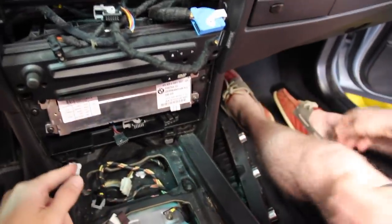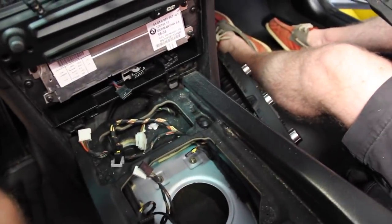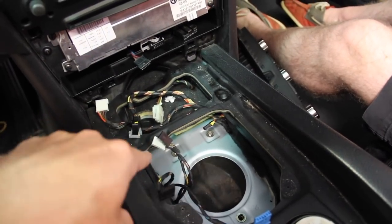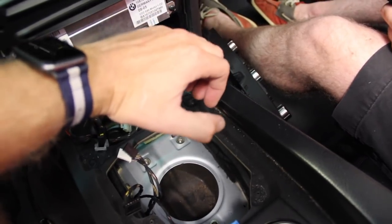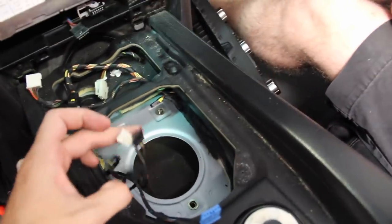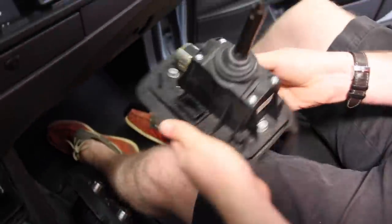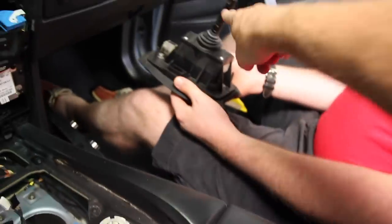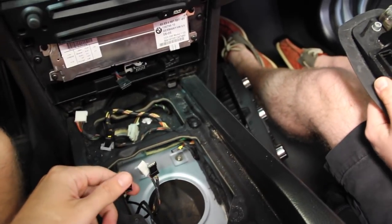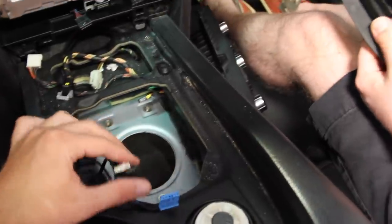After taking that apart, remove the aluminum center console trim. The SMG plate with DSC power and EDC buttons just pries right up with your fingers — no tools necessary. There are about five or six wires connected, they just pull off with no tabs or clips. If you can't reach those, the SMG shift knob is installed just like a normal manual shift knob. Open your sunroof, take a seat spread eagle over the center console, and pull up firmly — but once it gives, don't rip all the wires out. Disconnect all the wires and set it aside.